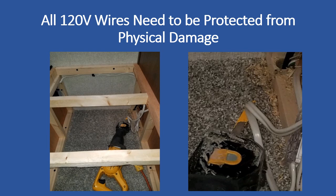In the photos below, we see an example of a storage area under the dinette seats, which are very common in many RV models. The 120-volt Romex wire is extremely low and resting right next to the blade of a saw. The photo on the right is a close-up of the photo on the left, and one can see how easily the wire could be damaged by the sharp saw blade on the reciprocating saw. The customer who bought this RV could do significant damage to this wire by storing something like a saw in this storage compartment. This is why wire protection is so very important.